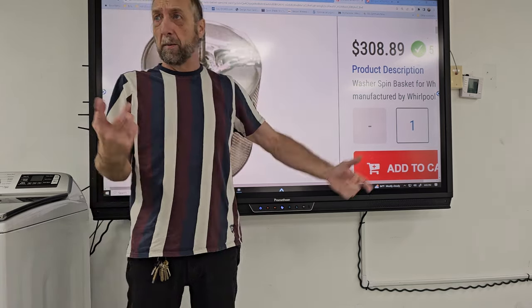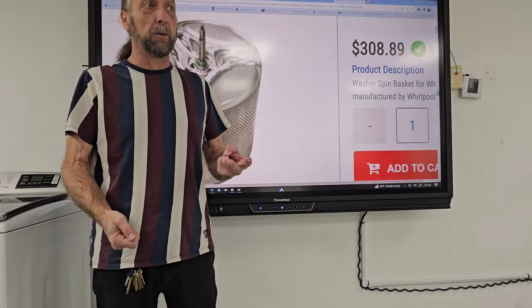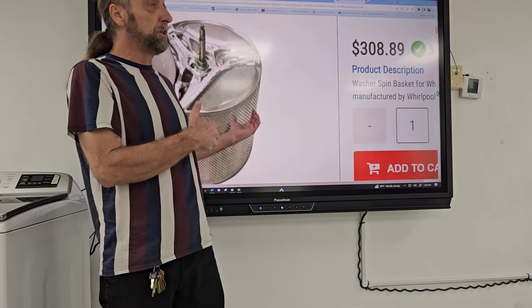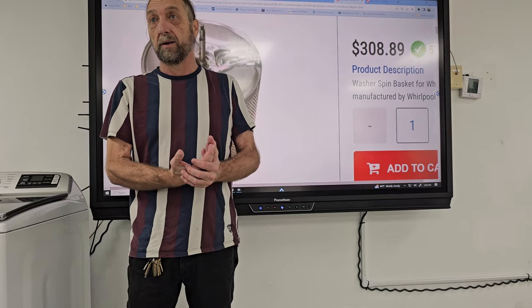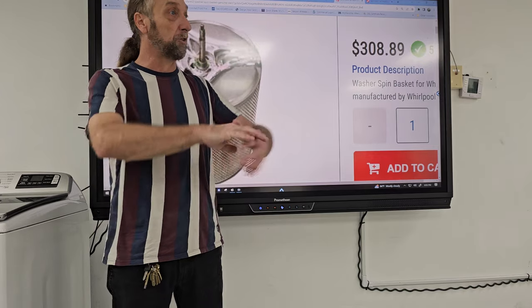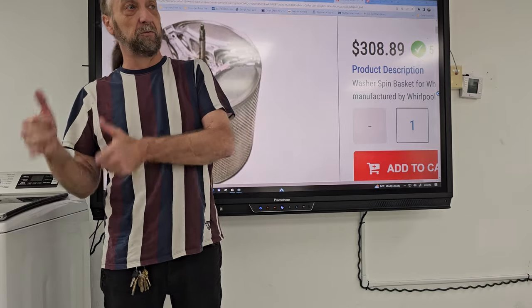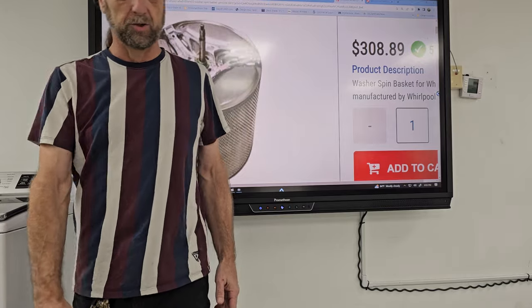Because you yourself, remember, what do I tell you guys? When you go to pull it out of the machine, you need a second man, or you're gonna damage that washing machine. So we would only do it if the customer has an extended contract or it's under warranty. And that's what happened to her machine. The shocks were all broken, but again, that doesn't fix the problem. They were broke because it was another problem within the machine.